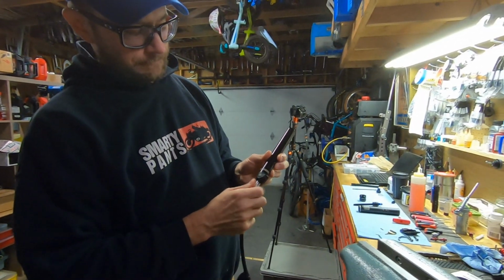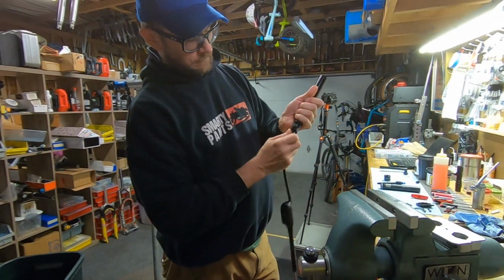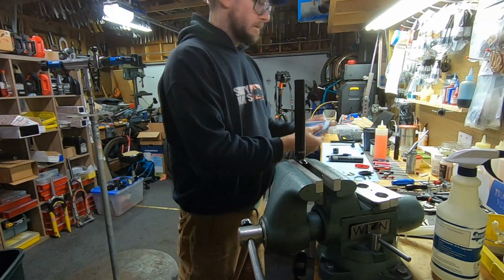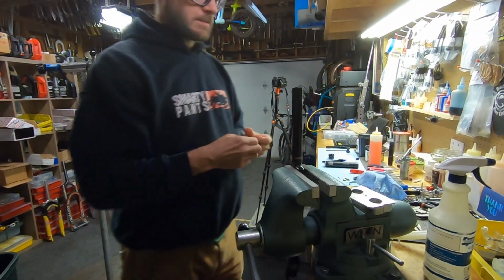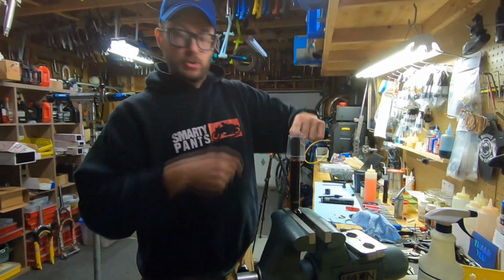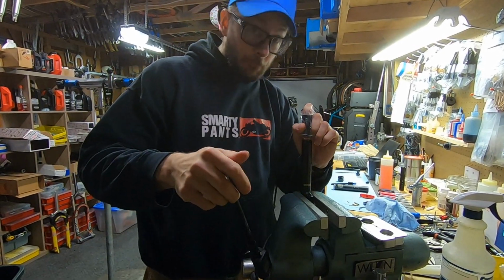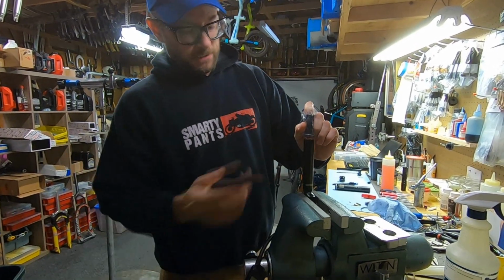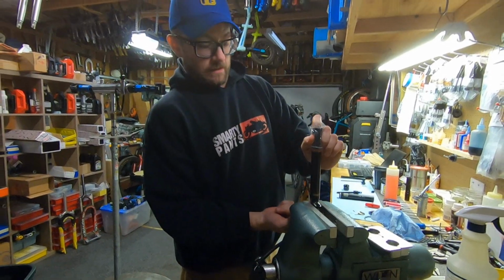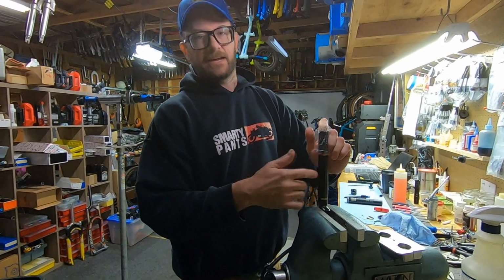I get it, but the way that I do it, and other people have done it too, is you hook the pump up, and then clamp it in the vise, and then you take yet another plastic bag, put your finger against the IFP tube, and you're going to pressurize the system, and it should go thump, because what you're doing right now is pressurizing between the seal head, sorry, the valve, and then you're pushing the IFP internally up.